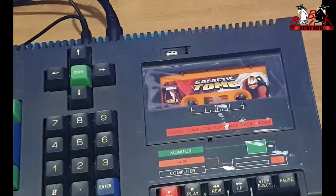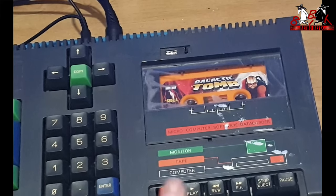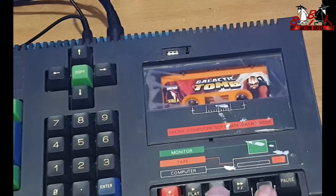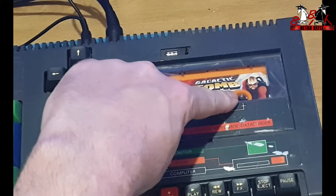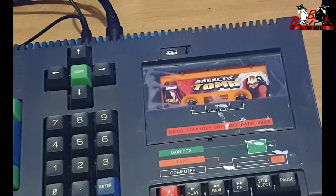I've got it set up on the screen now. All I need to do is press any key and press play. I'm just going to press play now and we'll have a listen to what that sound sounds like. You can hear it, can't you - you can hear it wobbling on the sound. Like I said, I believe it is the idler pulley. It could be the main drive here, because underneath that wheel there's a little fiber plate and a spring underneath there as well, so we're going to have a look at that at the same time.